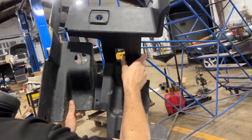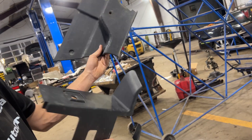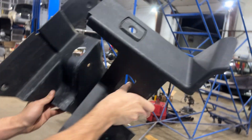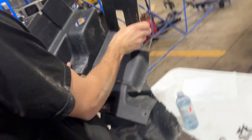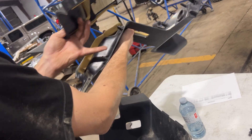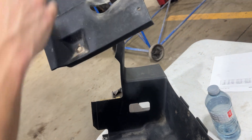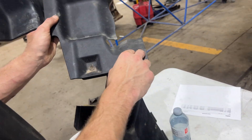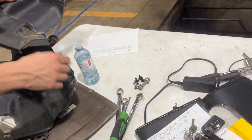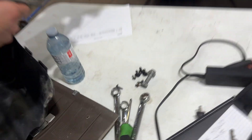Get this pried off and then pull this one off — there are three push pins on the side panel. For the other piece, you're going to have a bunch of pressure clips all along the top and those two on the side that link the panels together, along with probably some Torx screws on the bottom. My Torx screws were gone and we just had Phillips screws, but I guarantee you that you're going to have Torx on yours.